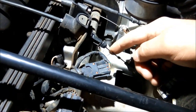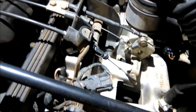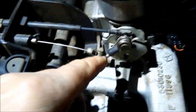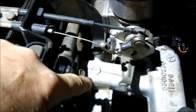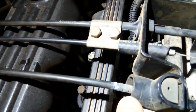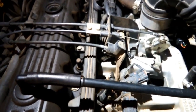I've adjusted it to the maximum so there's just a little bit of tension with the pedal flat to the floor. You can see the linkage has just started to rotate, and the mark has moved about a centimetre from where it was. I'm going to take it for a test run now to see how it behaves.